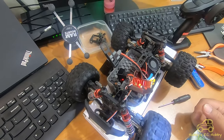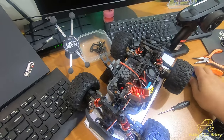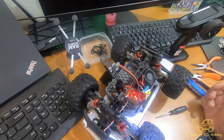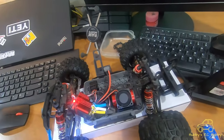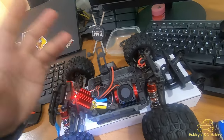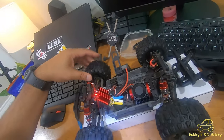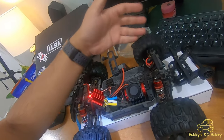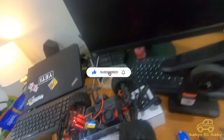Leave some comments if you know what it is or have suggestions for how to fix RC ESC issues. This could be an answer to your problems — if you've been trying to fix your RC and almost ready to throw away your ESC, don't do it yet. Your ESC might just need a good connection to the motor. Especially if your wheels turn and your servo works but your throttle isn't — that's probably a loose connection. Thanks for watching, please like and subscribe.